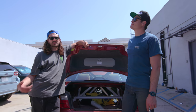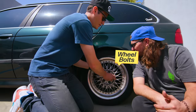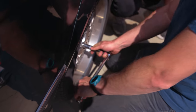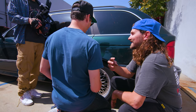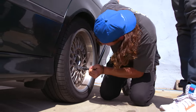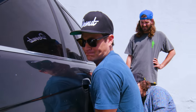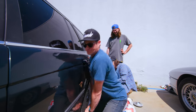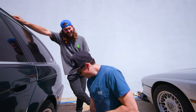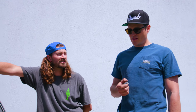Let's step things up. One of the most common roadside issues is a flat tire. So if you have to take a wheel off and put your spare on, can the Gator Grip do it? She cammed over there — it's just ejecting itself as you turn, just wants to come off. This is bull. You can never really use two hands on the tool — you have to have a hand holding it on. That feels terrible. We were able to break it loose with a standard 17 mil socket; it wasn't easy, but it got it off. It's almost like a specific socket is better. Bent the pins a little bit — did a little bit of damage to the bolts too. I think we call this a fail. This is a major fail.